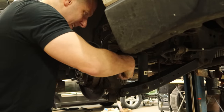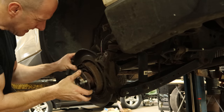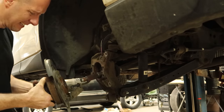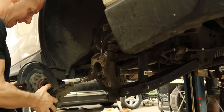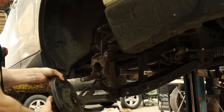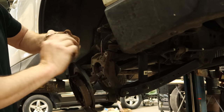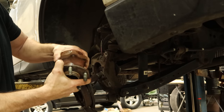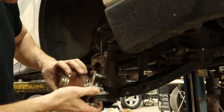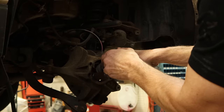So we changed its mind. Pull that bolt off the back. Now we can pull our hub out of our knuckle but not out of the backing plate. Slide it off the drive axle. That ridge of rust is going to make this a little difficult. We're going to need our handheld hub press — a couple taps and knock it out of there. We'll hang the backing plate up. I believe that's the noisy one. Got a little worm in there.